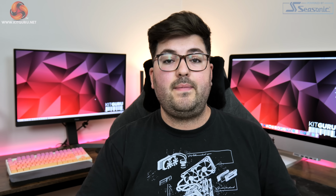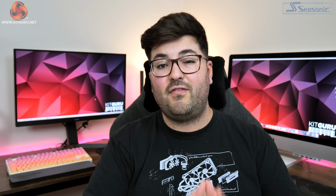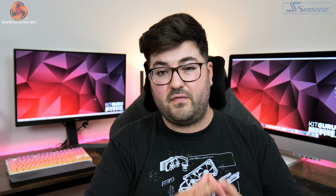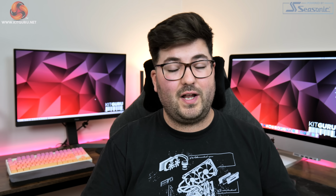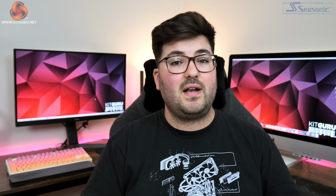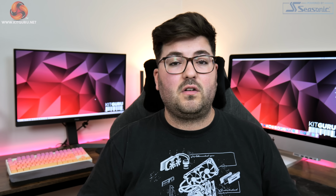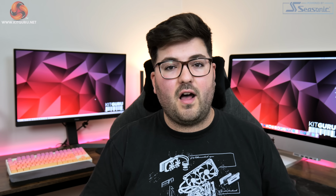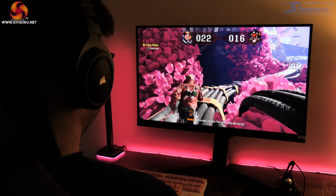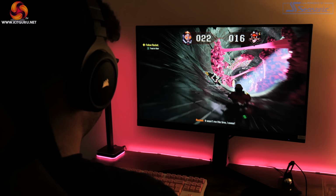Lastly then, the GB2770QSU does also feature Display HDR 400 certification, but anyone who's seen any of my monitor reviews will know I really don't consider this real HDR. In actual fact, this panel does have a decent brightness out of the box, but there's no local dimming. Even the relatively decent contrast for the IPS panel here isn't enough, so you're just really not getting a proper HDR experience. That said, considering the price point, I'm really not going to hold that against this screen.